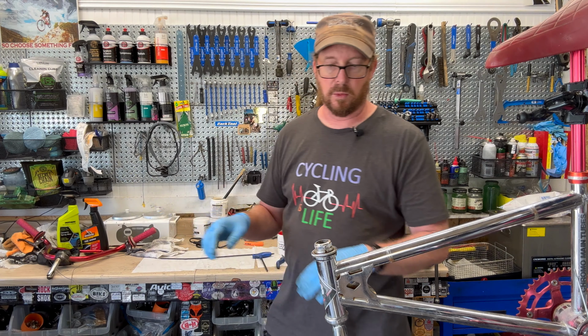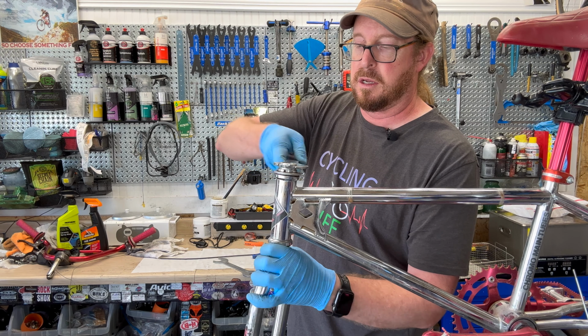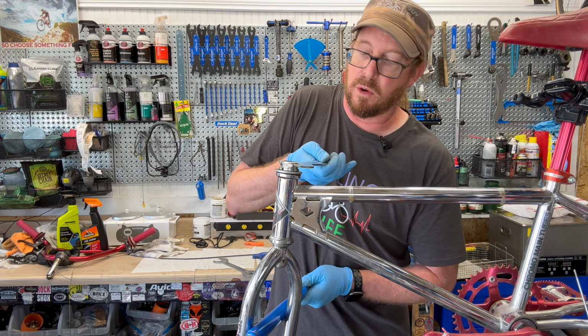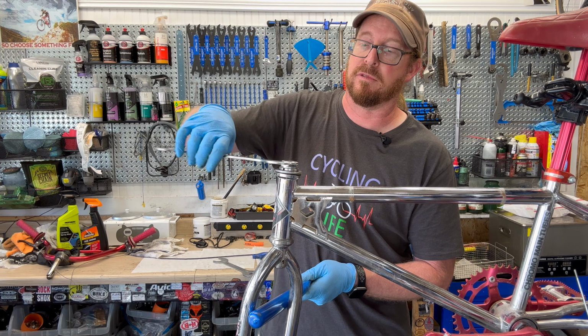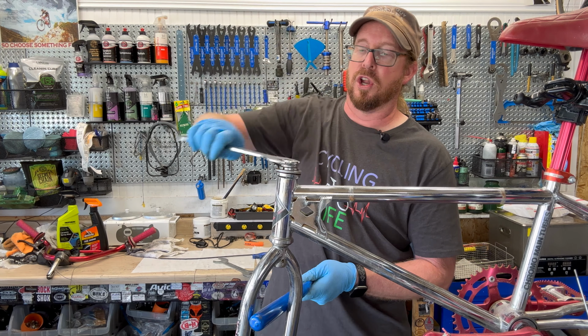So this looks like a 30 millimeter. Well, maybe. Yeah. And since the bars are off, now it feels a little chunky. Okay, so if you don't have the wheel in there, which I don't, you can take some long shaft rubber thing to wedge it. But if it's really hard, get the wheel back in there, because you don't want to compromise the fork blades on this, because nobody in the world anymore has the fork mount or tool to realign and cold bend steel forks.